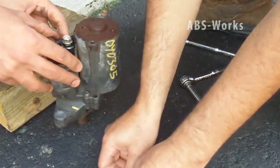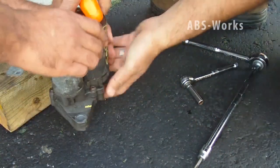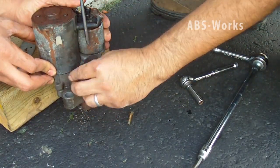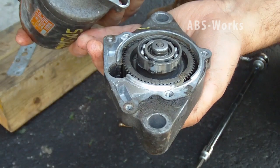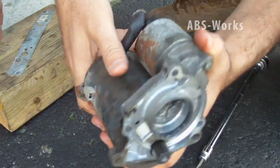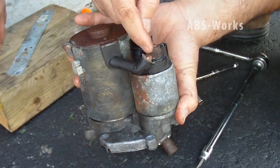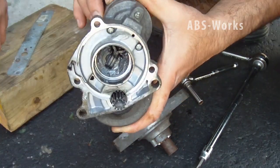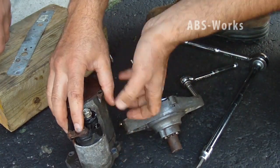The two screws are set aside. Using another screwdriver I remove those screws. Here I remove this piece — this is the bottom piece. Most of the time the problem will be within the solenoid or inside the motor. I have to remove this screw so this wire can be detached, then I'll work on the solenoid. In order to remove the solenoid we need three screws to open.